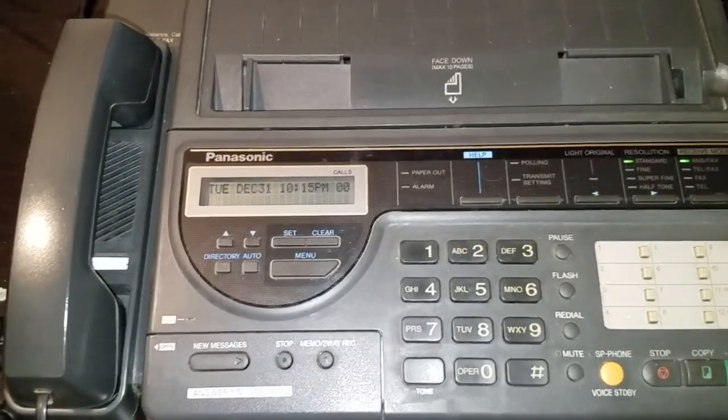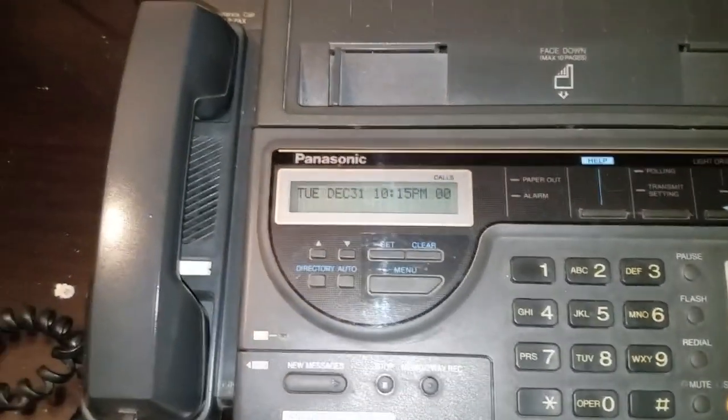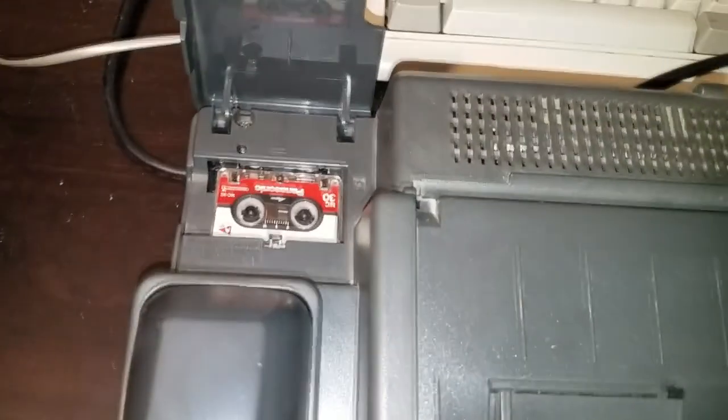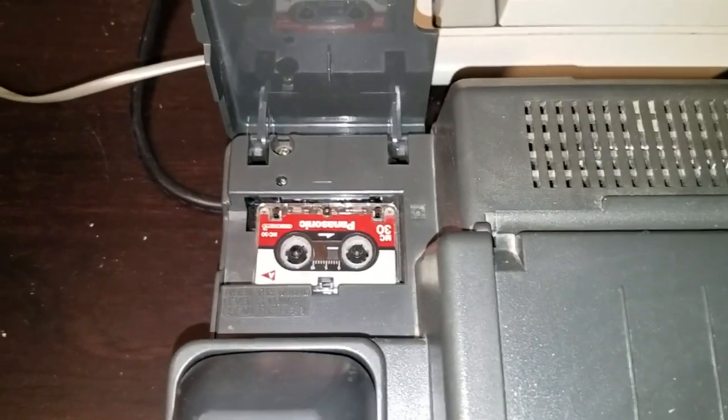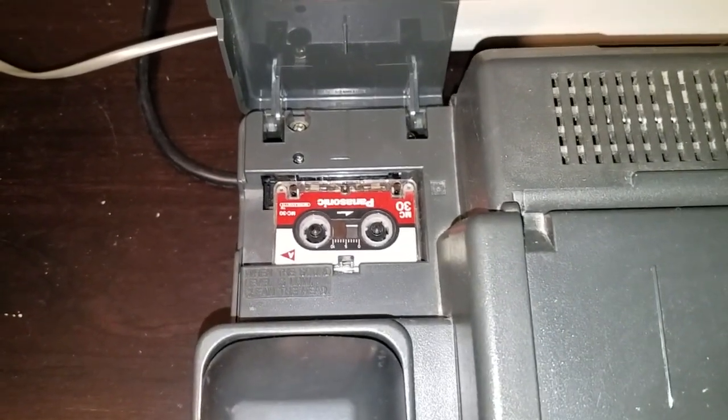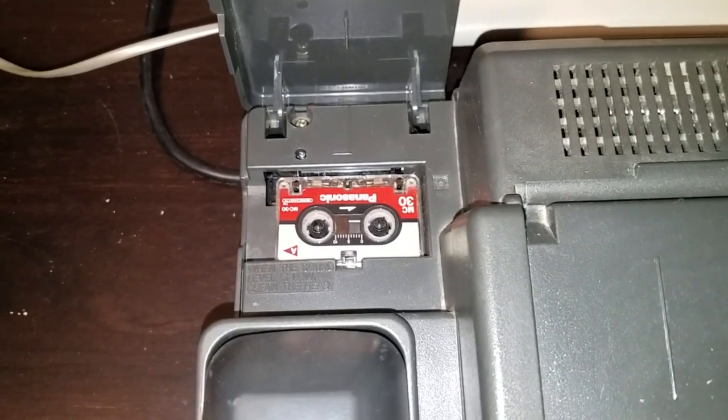The answering machine doesn't sound the best. You can hear a ton of flutter in the recording. But I chalk that up to just two things. First of all, the new belt that I'm using is not the proper one. That might contribute to it.